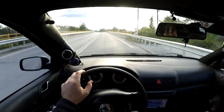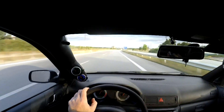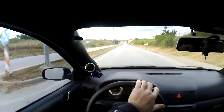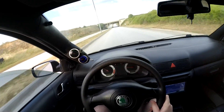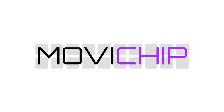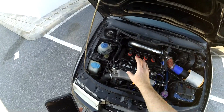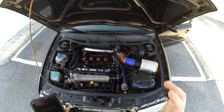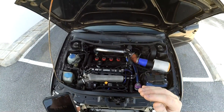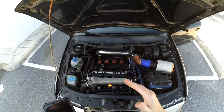I've got the engine recording. What you can hear in the background is the signal from the knock sensor being recorded by the laptop — 4,500 RPM, 5,000 RPM. Let's do a quick second gear pull. So that was the audio recording of the knock sensor. The first thing is I think the knock sensor location is fine, if not good. The signal was very clean and good quality. And secondly, there is a little bit of knock on the engine at lower RPMs and higher loads, which is something to bear in mind in the next step — programming the KSC3 to start registering knock.